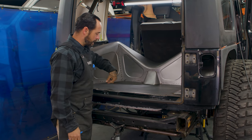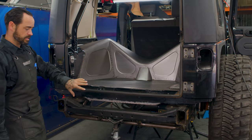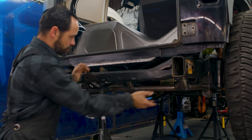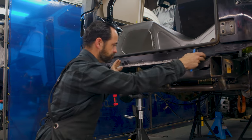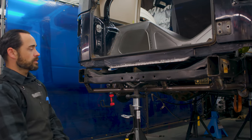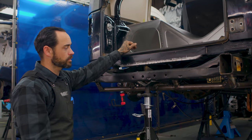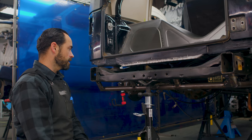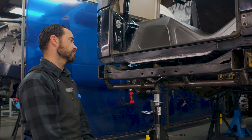The factory Jeep has this storage basin. The packaging under this is like a cradle — another extended tube structure under here. There's a really hardcore air compressor, a big tank that goes in here, the battery, and the exhaust is going to dump flat with the profile of this cradle. Going back to that basin, we had to delete it — it made more sense to get all our packaging done outside of here. Having the compressor outside the cab, with all the mechanicals and systems outside, is what made sense for this application.